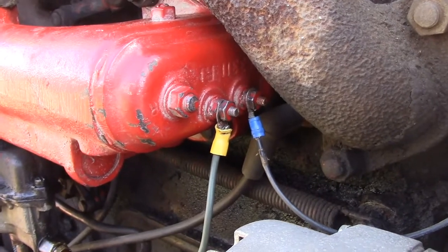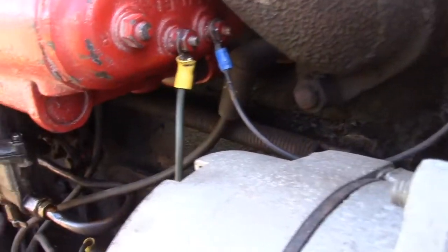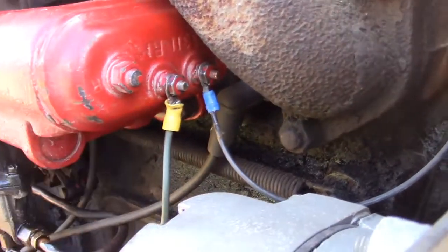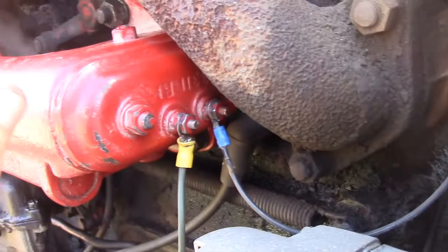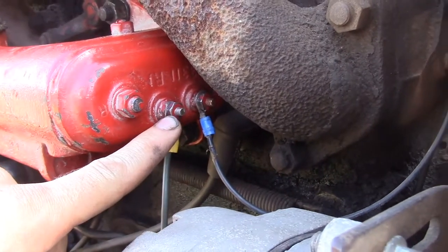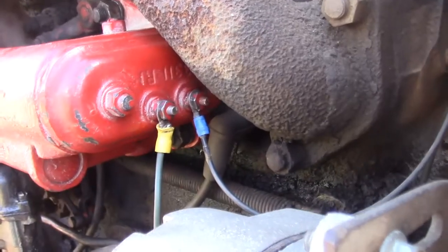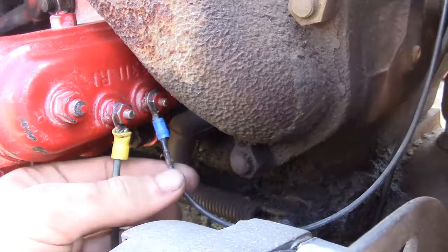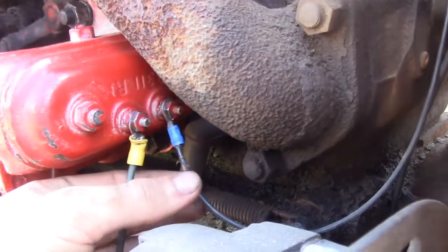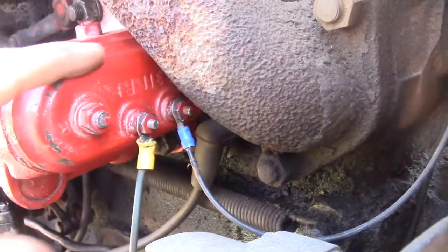In the front of the manifold you have two wires — or sometimes just one. Underneath this cover is a round contactor that turns. When it's on the gas side it turns so that there are two brass connectors that make contact between this post and this post. A lot of times that connector goes bad or the disc gets worn out. When you put it on the gas side it does not let the voltage travel from this wire through to this wire to go to your coil. If you see them wired from here to this post, or wired to the same post, it's a good indicator that the disc underneath is bad.